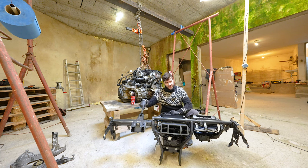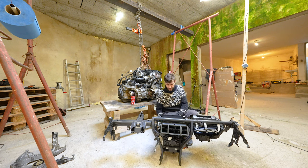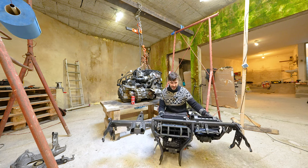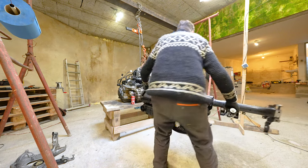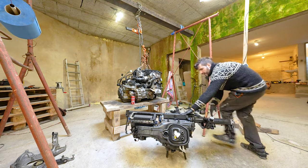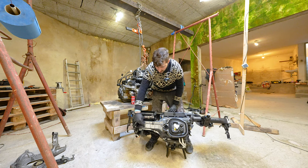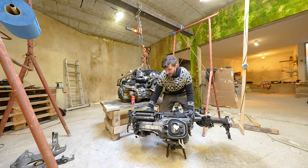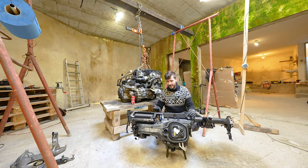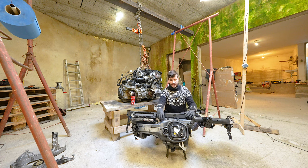This is the screw that you need to undo from the front side underneath the windshield, behind the windshield wiper motors. And the reason why we had to remove all of this is, excuse the view of my behind for a second, there we go, because this lower part is what's broken. So this is where we have the crack on the front where this thing mounts to this frame, and you cannot get it out any other way. This, on the other hand, is going to allow me to completely clean the insides of these vents and these flaps and whatever there is inside.